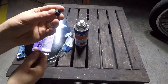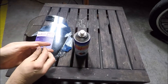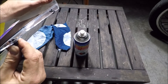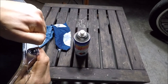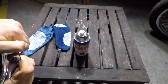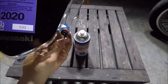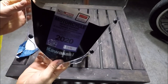Now to place the rubber grommets into your new screen, do the same thing with WD-40. Get your screen, pop as much as you can through, and then just rotate the grommet in. Put a bit of pressure on, all whilst turning, and there you go. Repeat that for all four and then we're ready to put the new screen back on the bike.